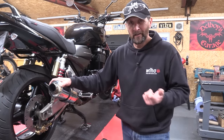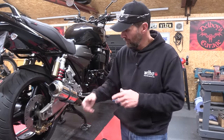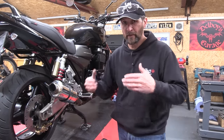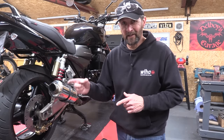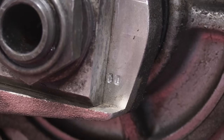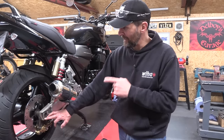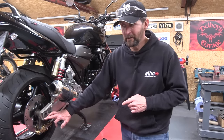Now the eagle eye amongst you might have spotted that I haven't done the back end up properly. I haven't done up the axle or torqued up these caliper bolts or done the wheel alignment or anything, and that's because it's all got to come back out again in the next video. If you take a look at the chain adjusters, you'll see here there's absolutely no adjustment left whatsoever on that chain and sprockets. It's completely knackered. So in the next one, we'll change it. I'll see you then.